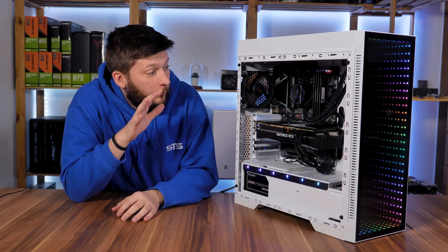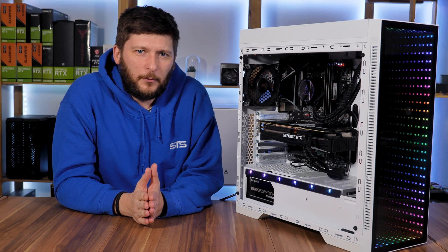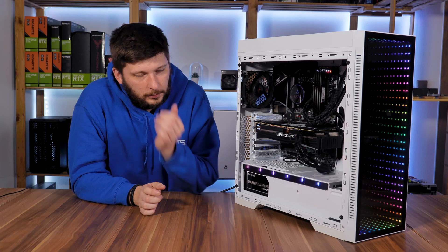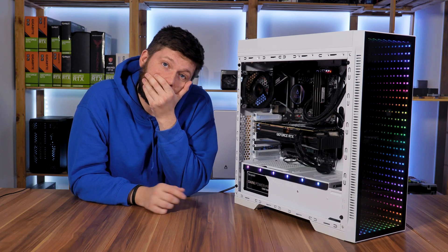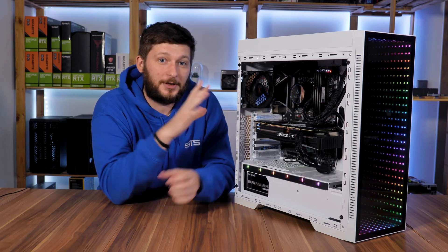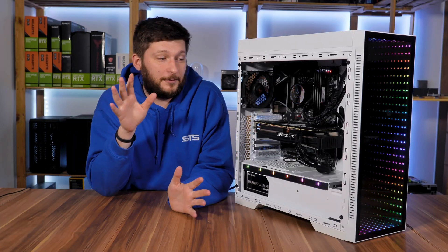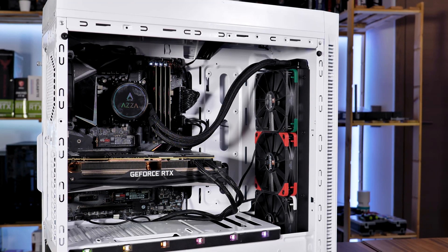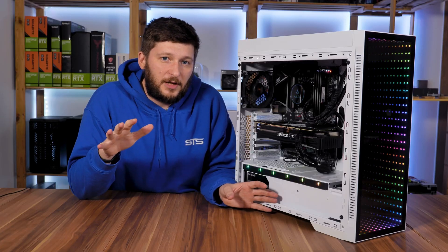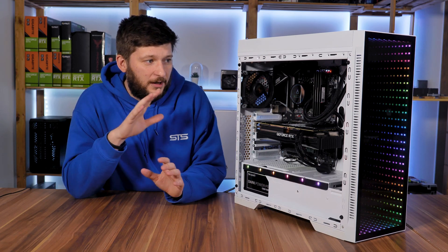I have a really annoying issue. This piece of crap prevents me from working. We have a couple of issues inside this rig. First off, my i9 throttles. I tried my best by using the biggest all-in-one I had, but the front airflow of this case is just meh. I'm not even able to keep it at 5 GHz all the time — 4.8 or 4.9 is okay, but that's basically it.